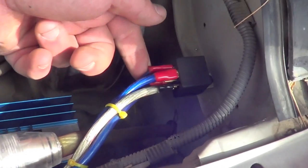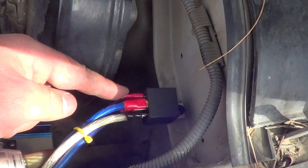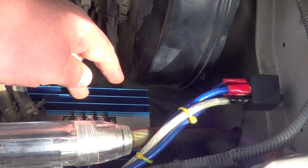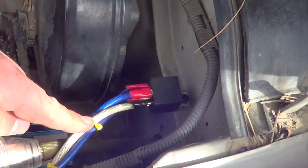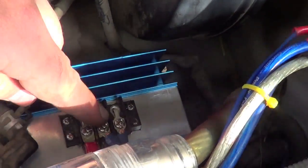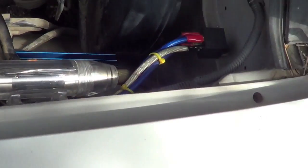The 86 wire goes to a remote wire — I've got it set up inside the cab so that if the engine is off and I'm not on accessory, this is off; otherwise it would be continually running and drain your battery. Pin 85 goes to your ground. I've got it grounded right here — make sure you get off all the paint and make sure it's a good ground, otherwise you'll have voltage issues.